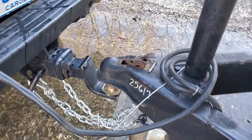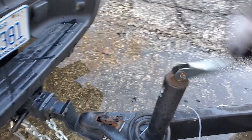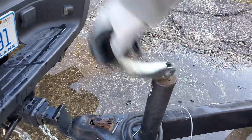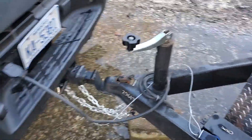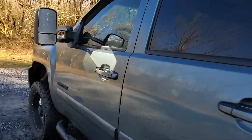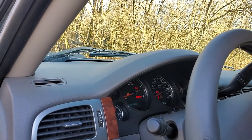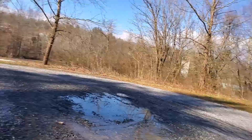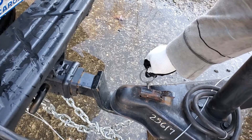Now we're going to lower the trailer down like this, all the way up — foot all the way up — until it stops. I knew that was gonna happen. All right, so we're going to go back up here to the truck. We have to put a little tension on the trailer so that we can lock the collar. Now we'll come back here, seat the collar, make sure that there's a pin — it goes through here — put that over so it doesn't come out. This is all your connections.